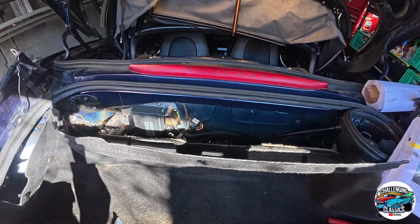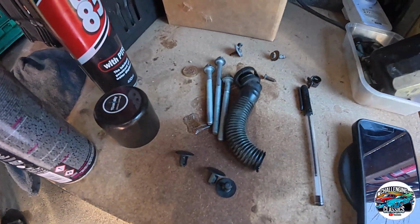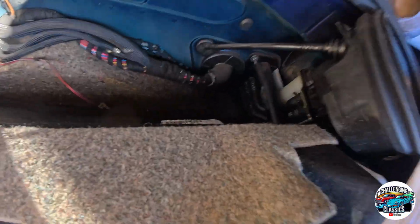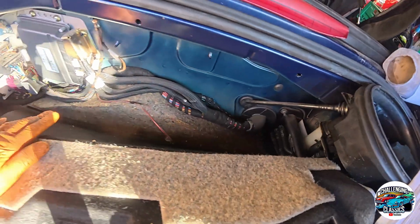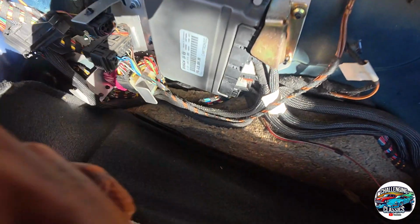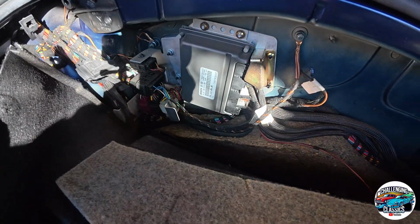Okay, so we've moved on. Air compressor bolts are all out down there. That's sitting nicely there. There was two at the top and one down the intake over there. So now we need to get the wiring loom out. It's got to poke through over there, go through the engine. Which is what it looks like beforehand, mainly for my reference this. But yeah, lots of these have to be unplugged and pushed back through so it sits on top of the engine when it's lowered. So let's crack on with that.